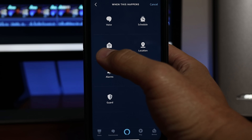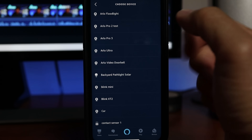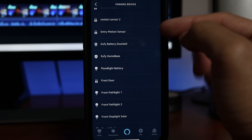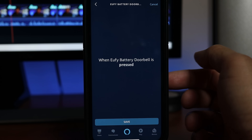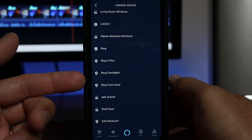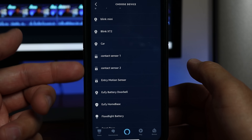On this video we'll set up Alexa to make an announcement when your camera senses motion. Not all Wi-Fi cameras are compatible — a lot of security cameras can be integrated with Alexa, but that doesn't mean they'll work with this setup. Checking which cameras are available for Alexa routines: Arlo cameras will work, Blink cameras will also work, eufy cameras don't work except for their battery doorbell but only when the doorbell is pressed. All Ring cameras and sensors will work, and for Wyze, only their Wyze sensors will work with this setup.